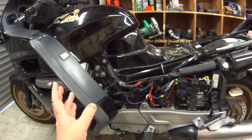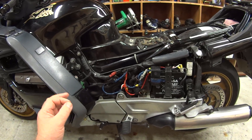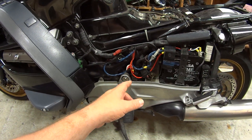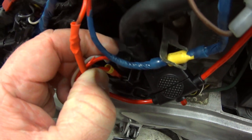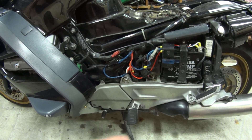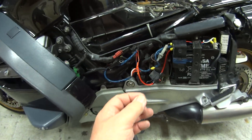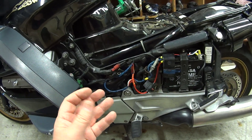That happened two or three times and then there was a complete roadside meltdown — literally. I checked all the fuses; those were fine. The 30 amp fuse which sits just behind here — you can see the green fuse right there — that had popped. I also noticed that the four wires coming from the factory loom into the starter relay here were melted.